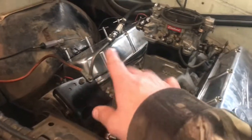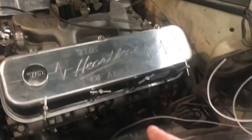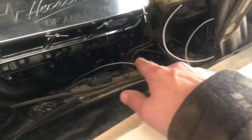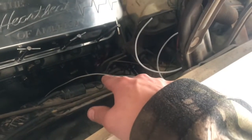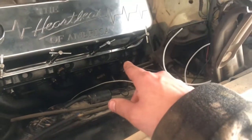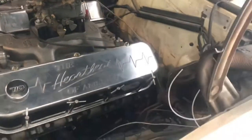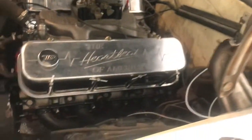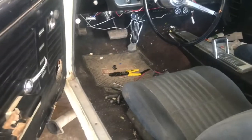I've just got to put the valve covers on and run the heater hose lines, finish up the starter wiring, and do the plug wires. Once I get my new gauges wired up — nothing special, just cheap Autometers — I'll spin the oil pump with my distributor tool and make sure I get oil pressure through everything. Then I'll put the distributor in and it should be ready to fire up, if there are no other complications.